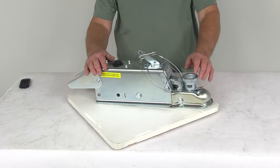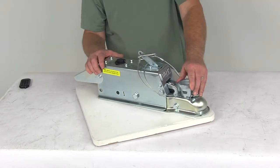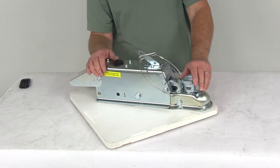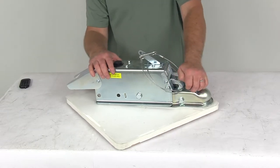This hydraulic actuator will synchronize your trailer brakes with your tow vehicle brakes. Basically, when you apply the brakes in your tow vehicle, deceleration will occur and the momentum will push your trailer toward the rear of the tow vehicle. With the surge brake system, the actuator is triggered as your trailer moves forward while the tow vehicle slows.